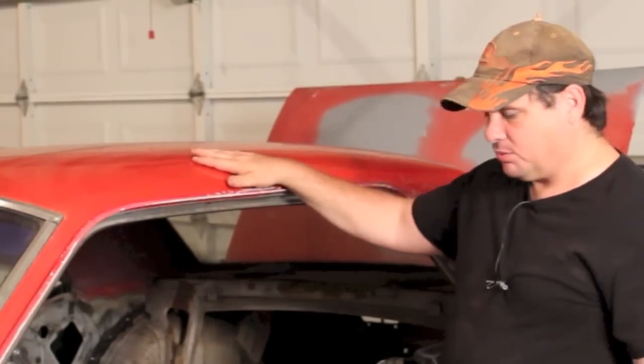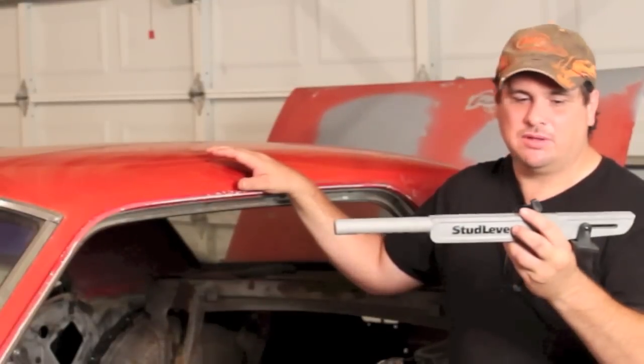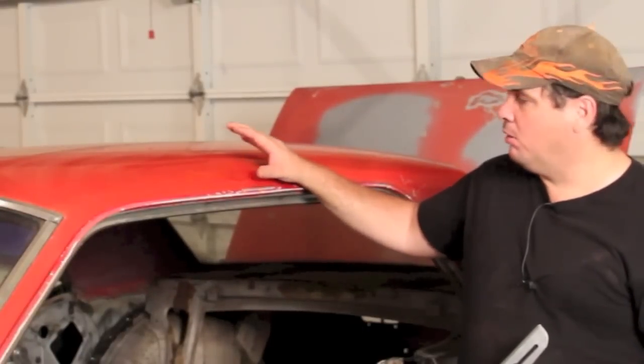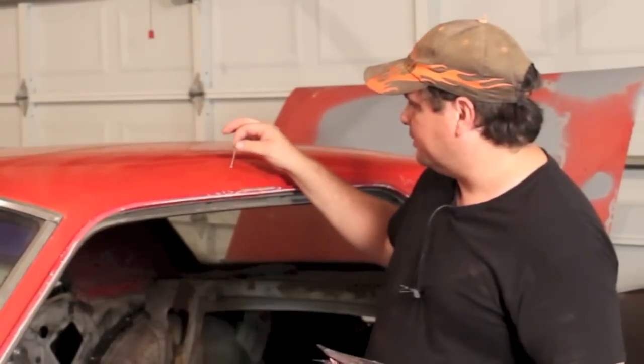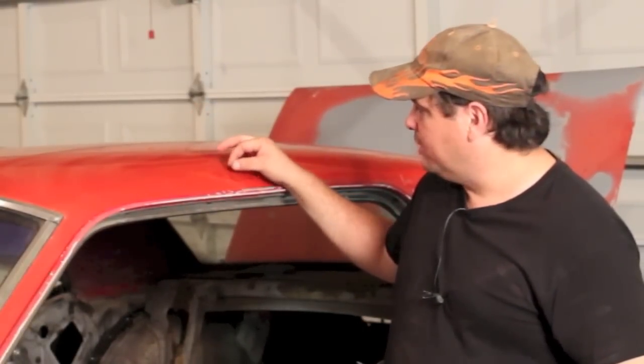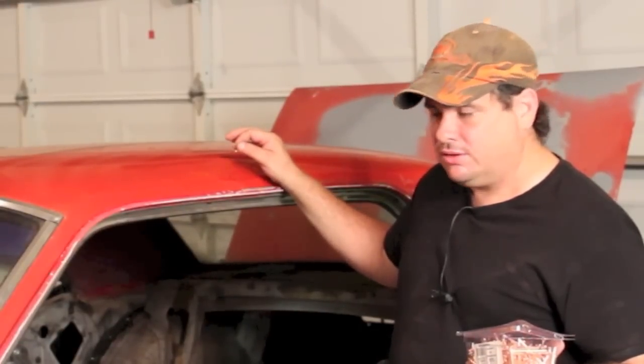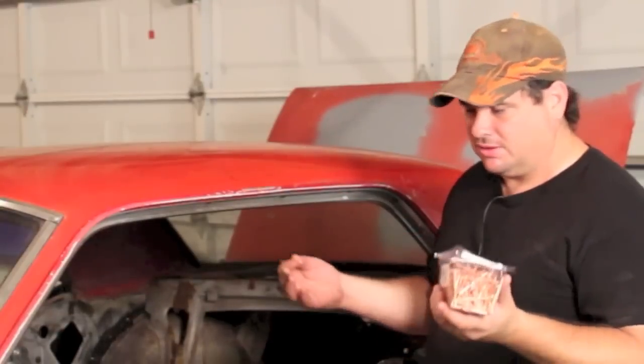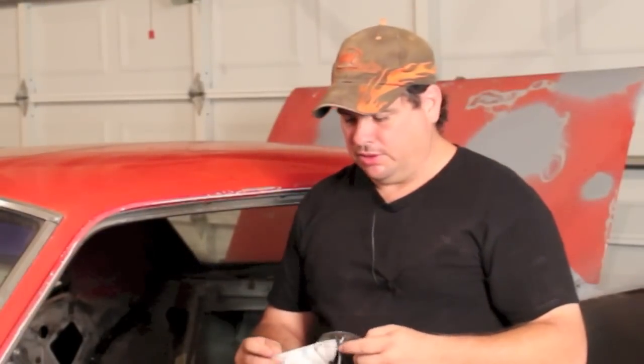Anyway, we're going to work on this and let you know how it works. What you'll need is this tool and a stud welder gun. I'm using as few tools as possible. This tool is something extra - you don't have to have this, it's just something I want to test out and show you. If you have a compressor, an air grinder would work really good. I'm still just using my cordless drill with a roll lock disc on it, and we're going to grind this area. This does have to be all metal to use this method because these studs are actually welded onto the surface. So in order for the stud welder gun to make contact, it has to be metal. This is not the only method you could use - you could drop the headliner and do some hammer and dolly to get this out. There are different methods, but I just like showing you a variety of ways. And I want to check out this cool tool. After grinding, you're going to want to wear your safety glasses and a dust mask.